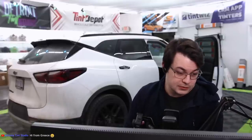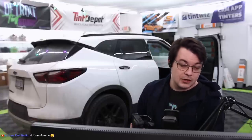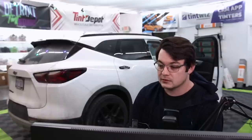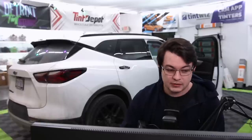Is the old Apex still worth it for the sides and back? I have a brand new roll. I was going to use it, but I keep hearing about it not sticking. No, it still works. So it's not about the doors. There's a little bit of misinformation. It's primarily on windshields. It has to do with the side frit lines. Sometimes it curls back, which is why they made a more aggressive one. It's the same base as C2 carbon, which doesn't have any problems.